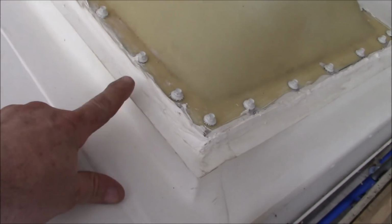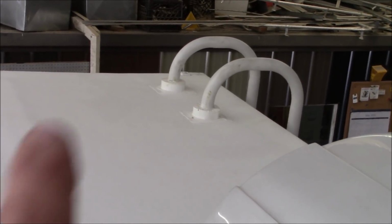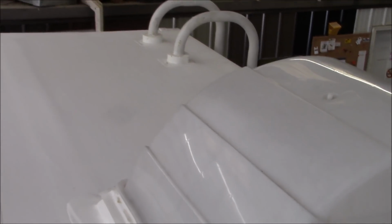So this is your flashing, this is your counter flashing. And we also do the same for the boots. We've got those boots over there, and those sit right down inside. They're screwed down, so they're fastened. There's a plate that goes around the actual arm. There's a plate, and then we put the screws in there. And then once we do that, we load it. So that's all loaded. We got another plumbing over there, did the same thing.